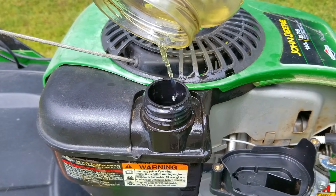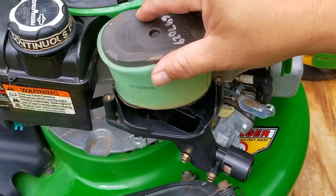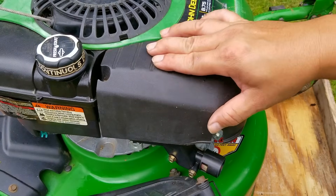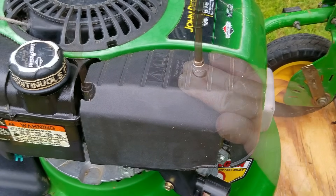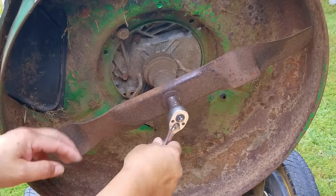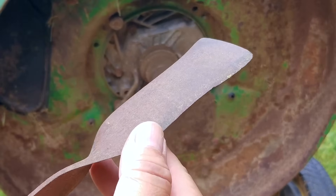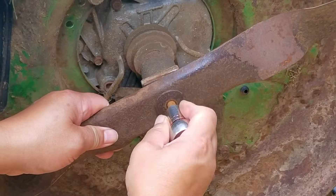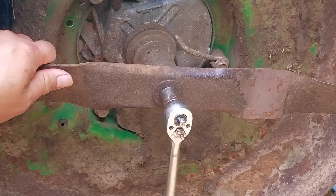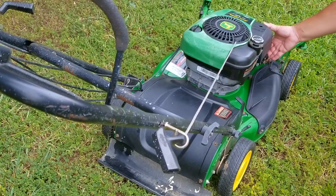To prove that the old gasoline I took out of the tank is still good, I'm going to carefully pour it back into the tank. I will not be replacing the air filter because, as you can see, the pre-filter is almost spotless, and the same goes for the paper element as well. Before I get the mower off the table, I also want to remove the blade and inspect its condition. It's in pretty good shape with only a couple of minor gouges in the edge, but as usual, it's very dull. After using my grinder on the edge, it's now much sharper. So I'm going to reinstall the blade, take the mower off the table, and then try starting it — hopefully it'll work this time.